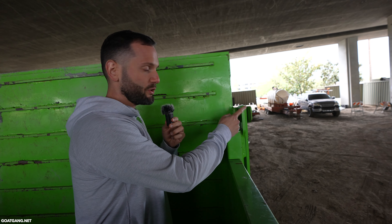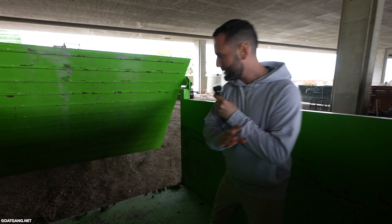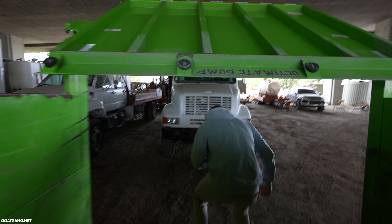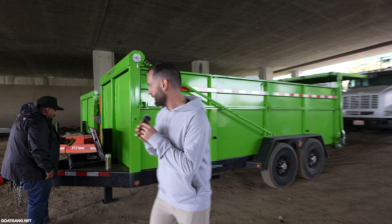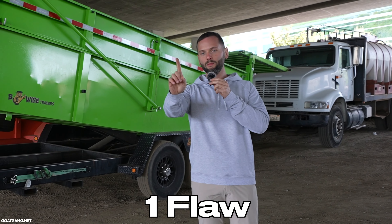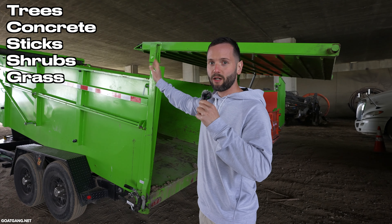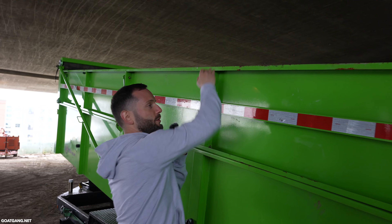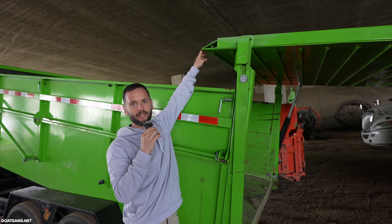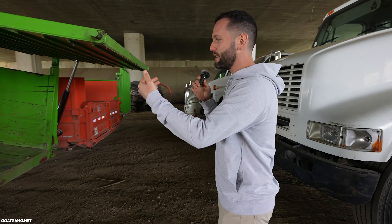This is the hinge point now, so the trailer cannot open this way — it has to open this way. Now we're able to dump materials this way. We're not going to go all the way because this trailer might flip, but you get the idea. This opens and the garbage goes out. But here is one flaw you must know: if you load the trailer up too high, the garbage always gets stuck at this gate. We've had this happen more than not, especially with sticks. So not ideal, but if you're doing dirt, concrete, materials that are low — it's good.